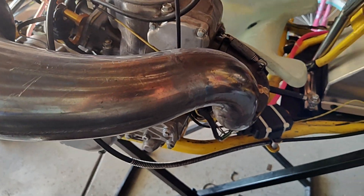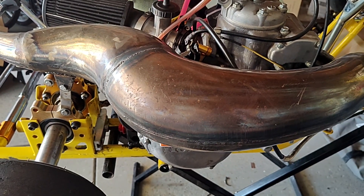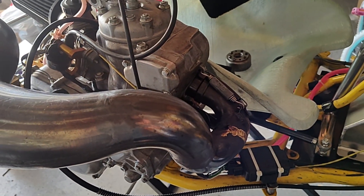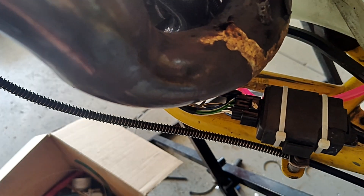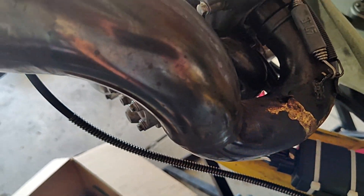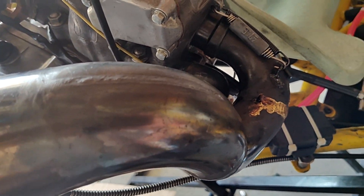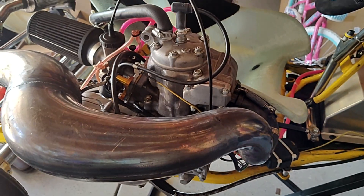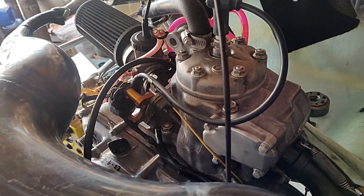But that's at the end of the project. Starting to pull everything apart, this has a modified motocross pipe. There is a very nice pipe available for the CR250 built by RLV — I'm actually a dealer for RLV — but that was not within our budget at this time. That's going to be a necessary upgrade in the future because, as you can see, it's cracked multiple times in the typical spot. It's not supported properly so it's cracking. I told the customer it's going to break — you can weld it, keep an eye on it, that's the cheap way — but the best way would be the RLV 250 pipe.